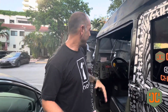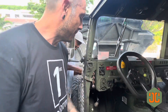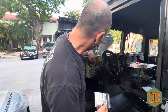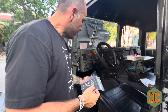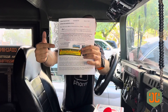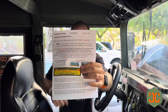This part of the install goes pretty quick — it's four bolts, two big connections, one on the top and one on the bottom. We're still waiting on the step bit so we can install this data plate and make a perfect little size hole. It also comes with a little warning decal that tells you not to cycle it longer than six seconds so you don't fry your glow plugs.